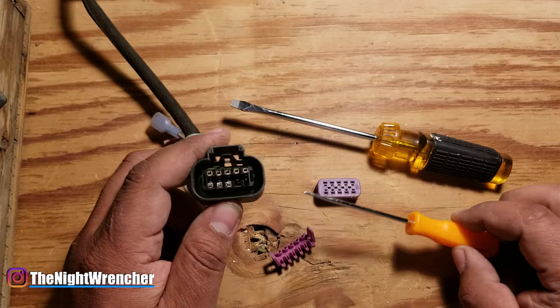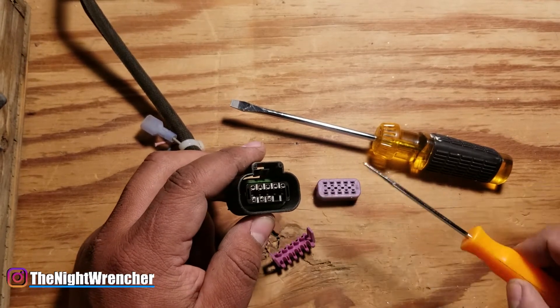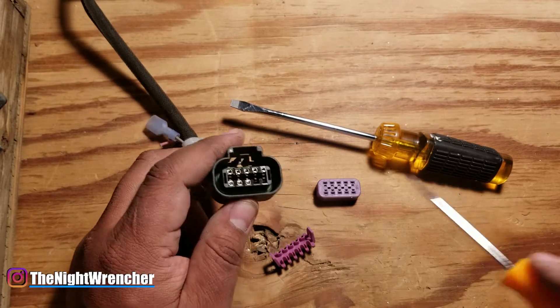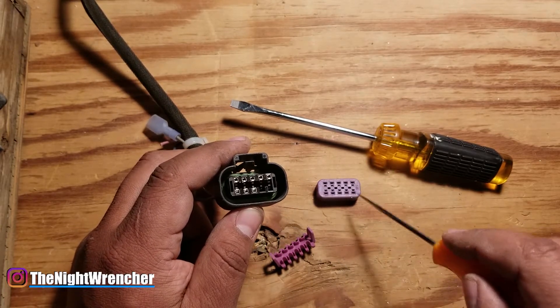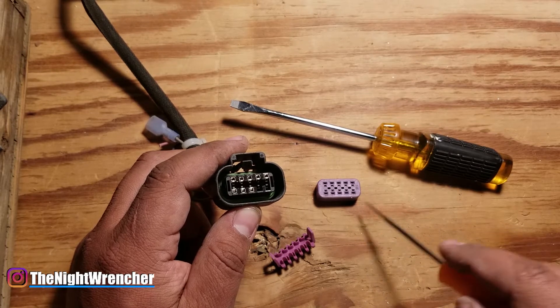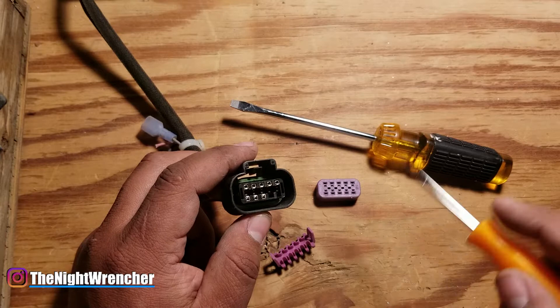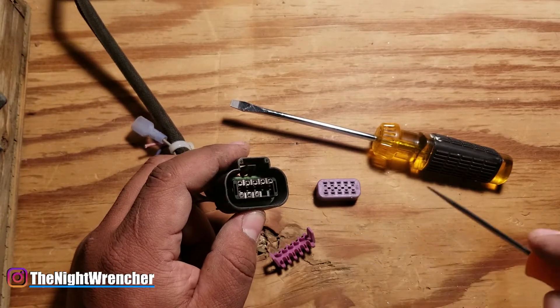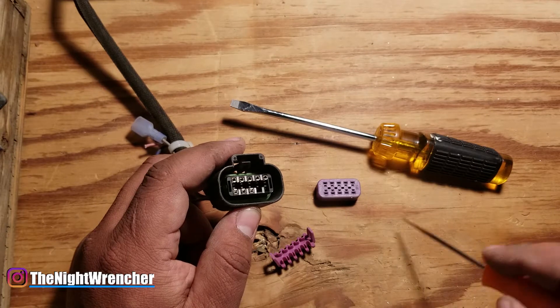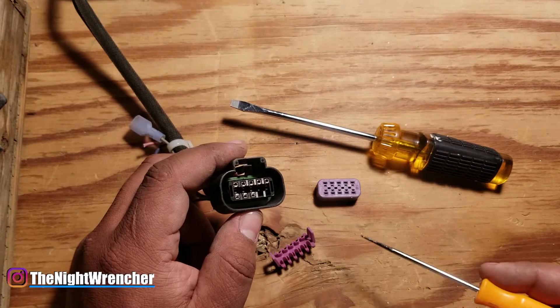The reason for that is he purchased the adapter harness for the SmartSpark LS that goes from 6010 to 6012 to the Daytona SmartSpark LS. When I called Technoline, they said it was compatible with the 6014, which it technically is because the connectors are the same and it will plug in. But the actual pinout is different, so he's got to unpin the MSD harness and repin it to match the Daytona harness.